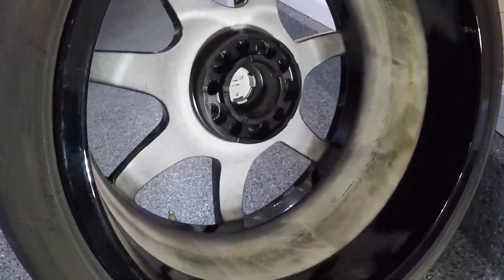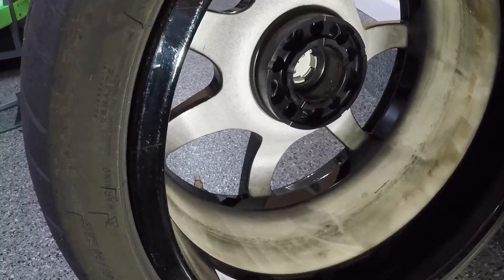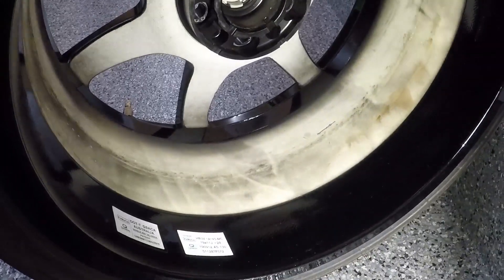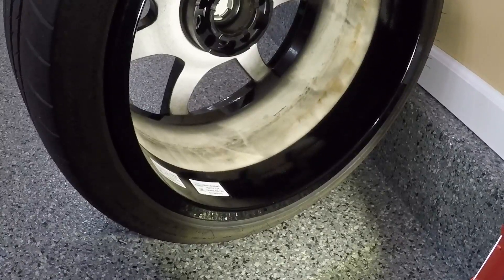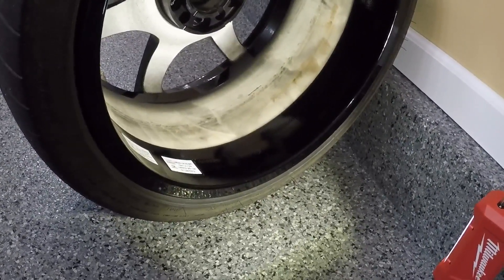These wheels are very impressive with how light they are. Ford has also claimed that because the carbon fiber is so stiff, it makes both the steering and the suspension more responsive. And if you look very closely you can actually see the weave of the carbon fiber in the paint. This is a really good enhancement to save quite a bit of weight and improve pretty much everything — the car will handle better, stop better, and accelerate better. It also cuts down on noise, vibration, and harshness since the carbon fiber naturally absorbs it.